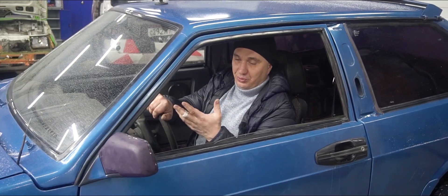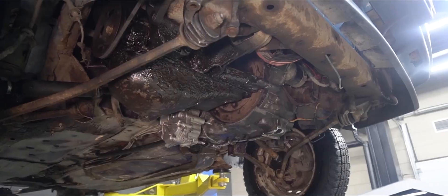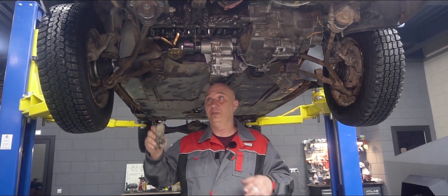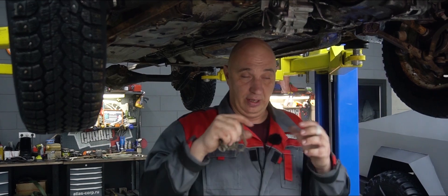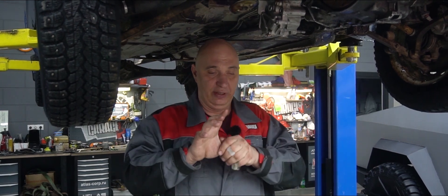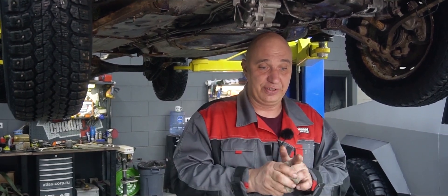I'm pretty sure that's the rod bearing making that noise. Without oil pressure, we might be looking at seized up main bearings. We've removed the oil pan, and there are actually a few things wrong with this picture. We made each makeshift bearing using one strip of leather belt, while factory bearings are two separate pieces. The belt is obviously thicker than the original metal bearings, and the leather would actually wrinkle up and get lodged between the rod and the cap.